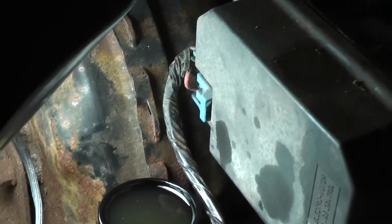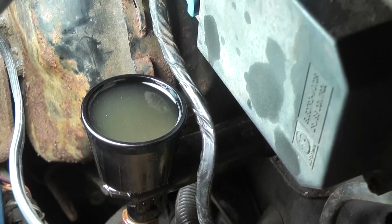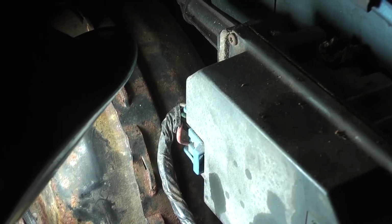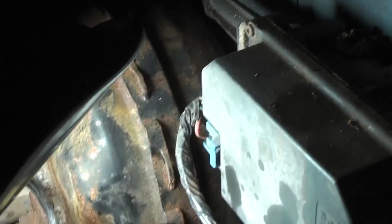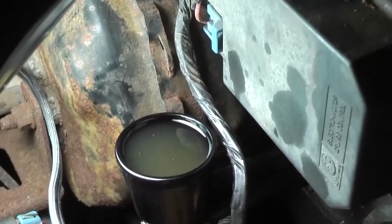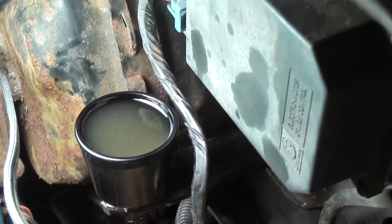I took the thing off, and after I bled it, I found on YouTube that you have to bleed the slave cylinder, but when you put it in, you have to compress the rubber boot and squish it in, in other words contract it, so you can push it in with your hand. With your hand it's pretty hard to do, but you can force it in, keep it in, and then put it in there. Because I think that's where I screwed up the first time I tried to put it in, that I felt it was binding, but the second time I put it in,